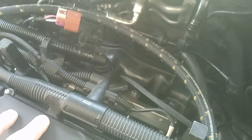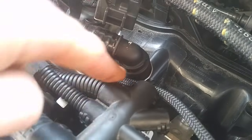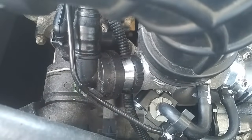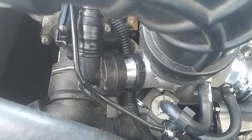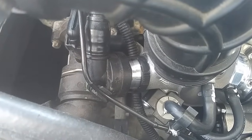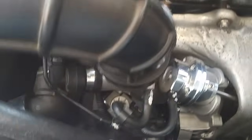When the intake is under positive pressure or boost — when your turbo is producing boost and you're accelerating — that intake manifold check valve closes and forces all the PCV gas to instead come up through here. This is a corrugated hose made of nylon. When you're removing this, be careful not to break it because it is pretty brittle and gets more brittle over time. The gas will flow out through here, out through the corrugated hose, all the way around the valve cover, and down to the turbo inlet. At the end of that connection is your second PCV check valve, which allows gas to flow into the turbo inlet but not out of it.